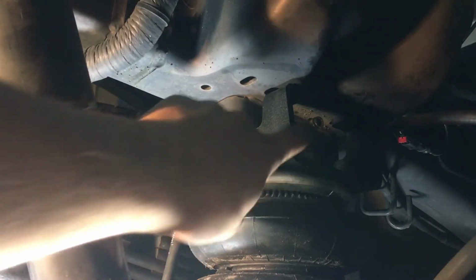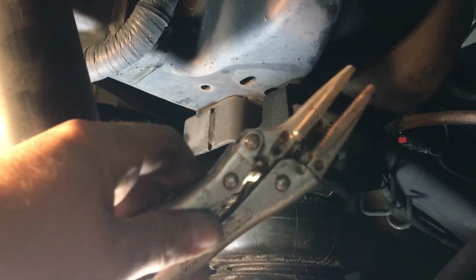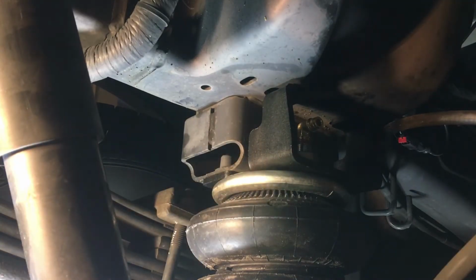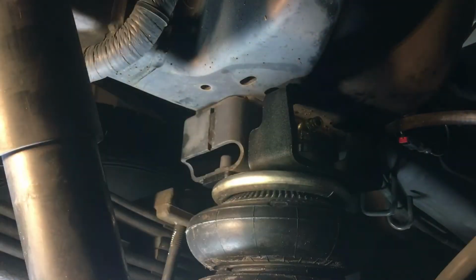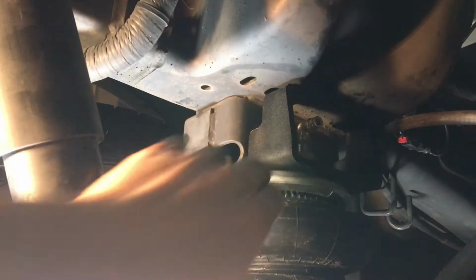All right, when threading these air valves in on the top, be very careful of the fitting here on the end. It's very delicate. Don't get a wrench on that. I used a 1/2-inch wrench, and I also did use a little pair of needle nose vice grips just to turn it around. It's kind of hard to bite on with these brackets on both sides, so there's a couple spots where you can't get a good bite on it, which is why I use the vice grips. Just be very gentle with those. You don't want to damage that. You'll have an air leak at that fitting there.